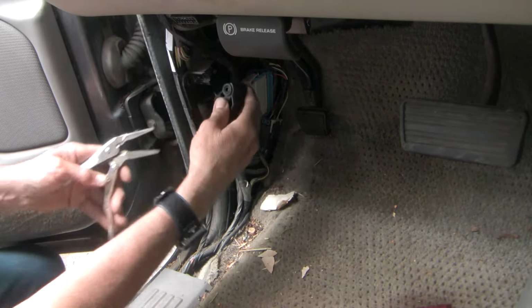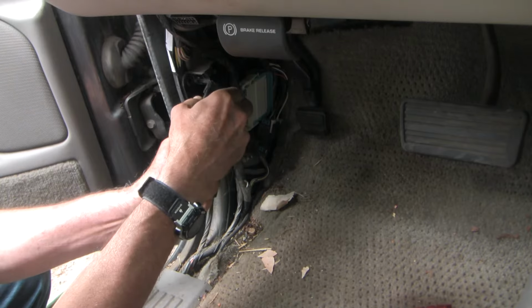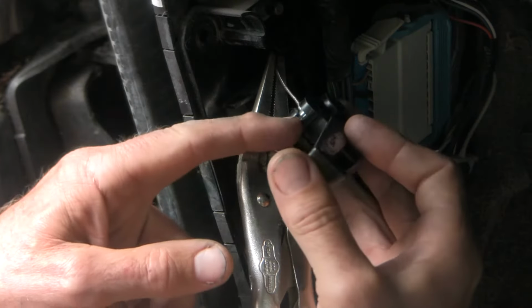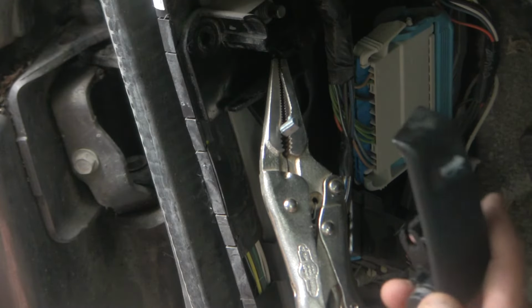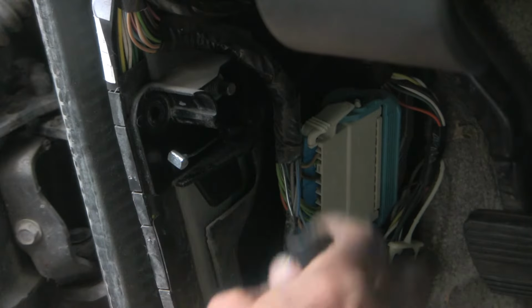First I want to take the cable handle off, so I'm going to pull it tight and then just pinch it with these locking pliers. So, like most things with plastic, there's a little bit of a trick to it. There's a little groove there. I'm going to rotate it so the cable's in the groove, and then it just pops out like that. Pretty simple. Now I want to get this housing off.